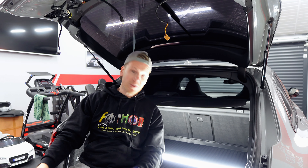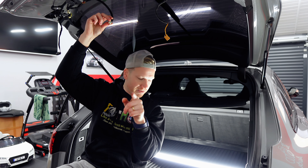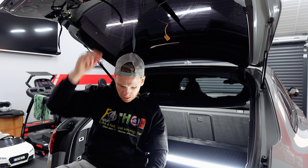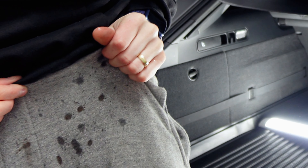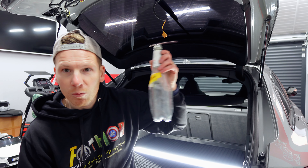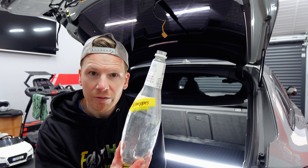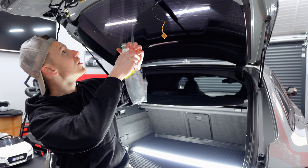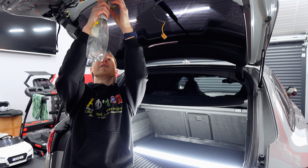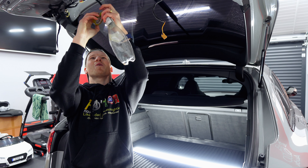There's water there. What I'm going to do is turn the ignition on, put the jet on, and see if water comes out here — you keep an eye and tell me if there's any water. If there is, there's a blockage just in that connection. If not, the problem's elsewhere. I've raided the recycling bin and I've got a little Schweppes Slimline Tonic bottle — I'm doing dry January, giving my liver a rest. I'll stick it in there and wrap a bit of tape around it to catch the water, so hopefully you guys can confirm that I've got no problem at all and it's just a blocked pipe.